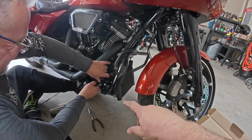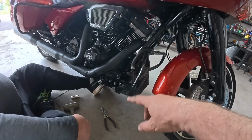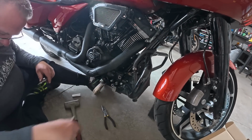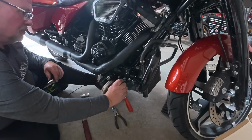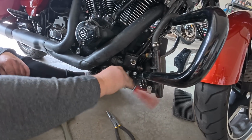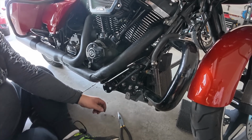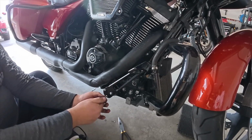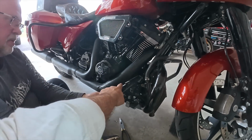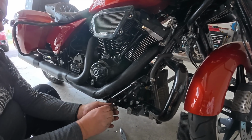One thing to note, and we thankfully caught it because I pulled up another video, is you got to make sure to use the stock bushing in there. So we put that in, put that piece on, and yeah, we're in a good spot here. Almost get this set. So this one is 3. Okay, that looks better. Can already see the different gap between the exhaust and the arm. I think that's going to be the setting.